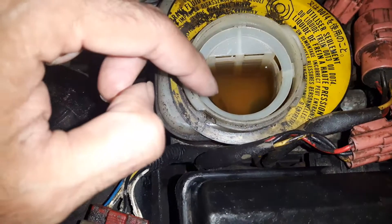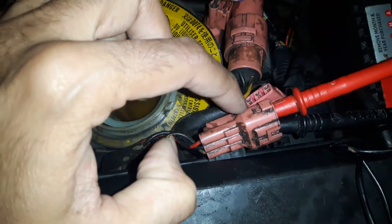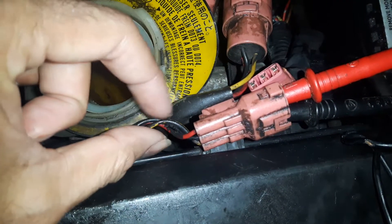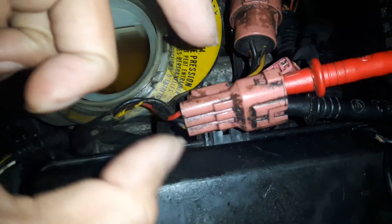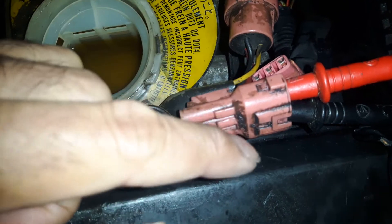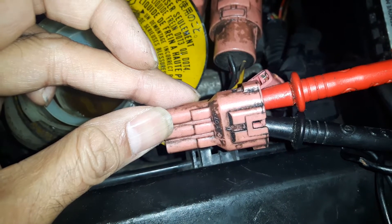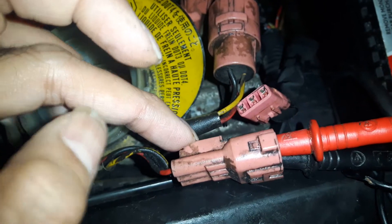The reason it's not working is because the rusty fluid has the solenoid stuck open. First, open the connector one at a time and measure the resistance between the center pin — which is ground — and the red pin, which is positive. Yellow is the other positive — one is directional flow in, one is out. The resistance between ground and the other two pins should be three to four ohms in good condition. Five or six ohms is acceptable, but shouldn't be much more.